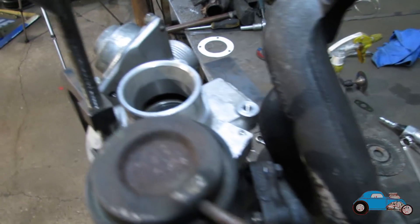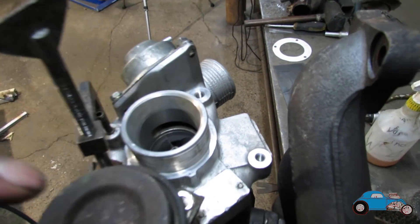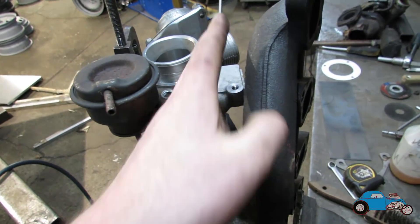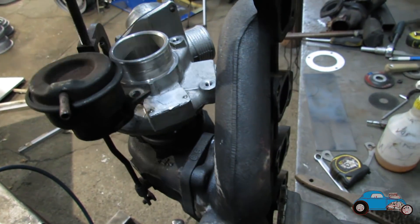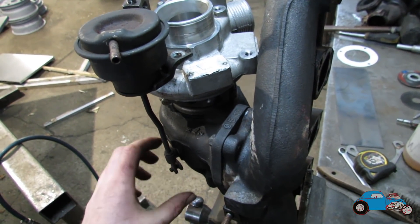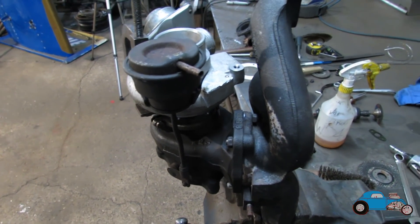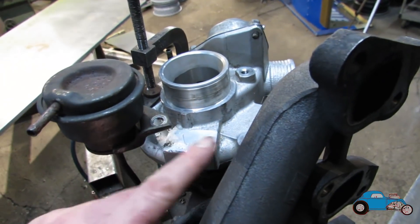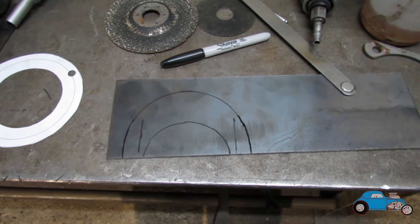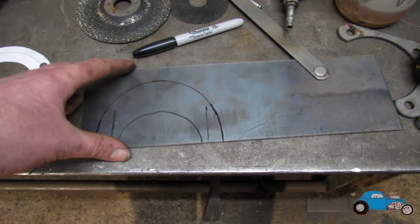I'm now going to fix the actuator to the turbo. There's a little bit of a modification here — the two holes which should be at the bottom to hold the actuator are now at the top, because when we turned the housing for the pipe to be in the right place, it put the holes up at the top. So now we've got to make a bracket to come off these two and then around to hold the actuator. As long as we can get the actuator to push the wastegate open when it over-pressurises, we should be good to get it on. I'm now going to fabricate something to hold that on there. I've got a rough outline to make a bracket — I think we're going to put a hole here, hole here, and hole there.